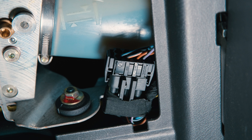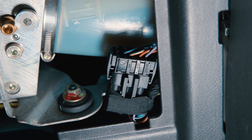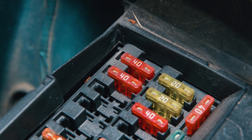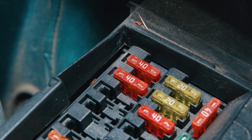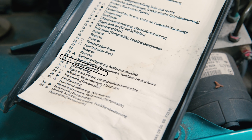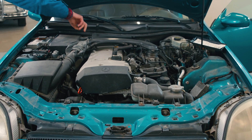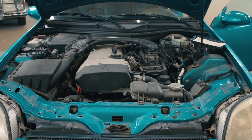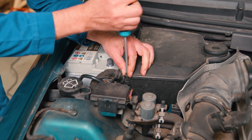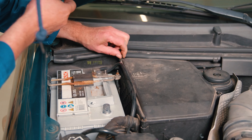This other 8-pin connector serves as the junction point for the trunk lid. Alongside the roof-relevant lock switch, it also houses lighting and central locking controls. The power supply for the pump unit in our 1999 model comes from fuse number 25 with 40 amps in the fuse box located to the left near the brake booster. The fuse box on the right manages higher-level main supplies. Now that we have a clearer picture of the end position switches, pump control and power supply, let's move on to the control unit in the module box.